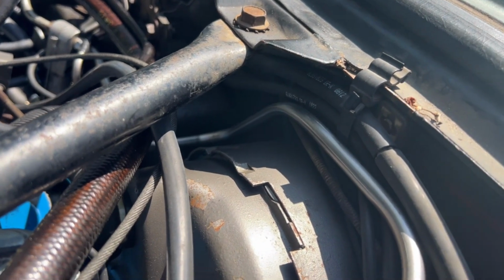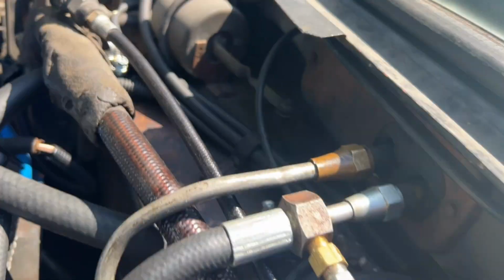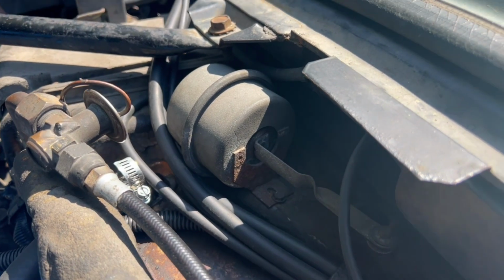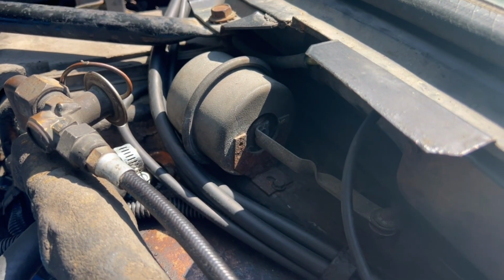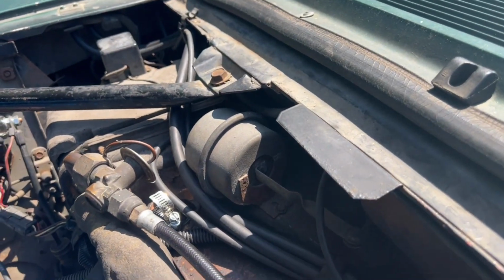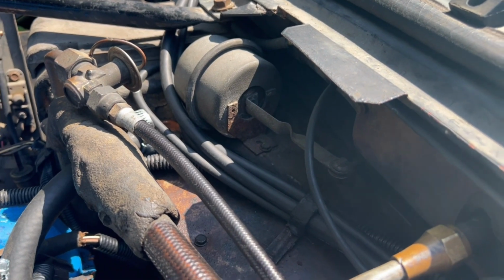And that is the source of vacuum that controls the vents inside, the heater valve under the hood, and the fresh air vacuum motor, which is also over there in the passenger fender. Now, since we're in the back of the ATC unit right now, there's two other hoses on an ATC car anyway. One of them is the mid-size one. That one connects directly to that motor right there, the blend motor. This controls the amount of heat that gets inside your car. Besides the heater valve, this is really designed to blend heat and cold together to get a comfortable temperature in the car. So it controls how much air, if any, is going to flow over the heater core or not.